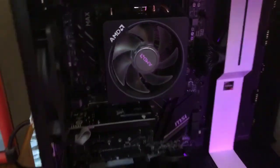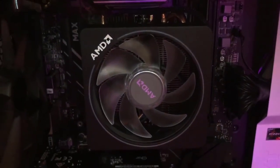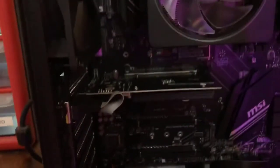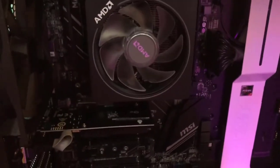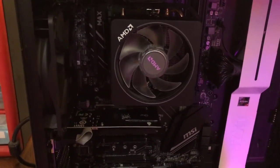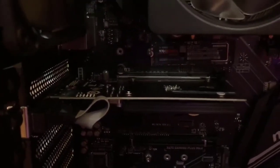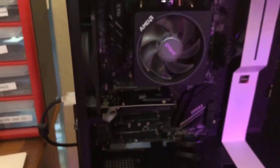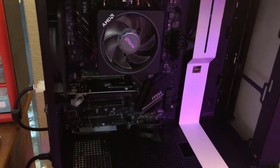I'm also kind of excited about it. Like, it's a silly mistake to make, but what it means is that every cent I spent on my CPU went to an investment in CPU power and not GPU power. So that's kind of neat, but all right, that's something to note. I thought I was getting one with integrated graphics and I did not. So yeah, I found that out when the system failed to post. There's some little lights over here. The VGA light went on telling me that there was no graphics available. So after checking manuals, I went and grabbed this little card. It should be good for a cheap computer build in the future, and I'll already have the part, but for now it is driving this machine's graphics.